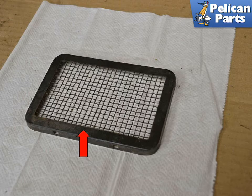A lot of people like to make their own filters for the airbox screen. Some people just place a dryer sheet between the screen and the housing, while other people cut furnace filters down to size. If you are going to install your own filter, I recommend spraying the outside of the screen with some matte tack or glue and adhering the filter of choice to the outside. This way it cannot get sucked into the fans.